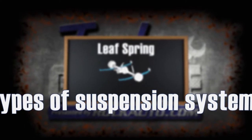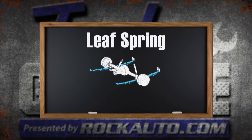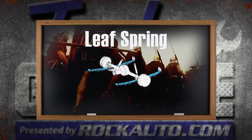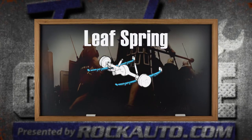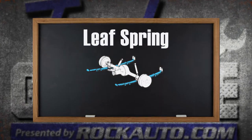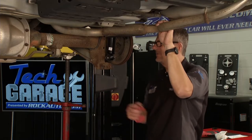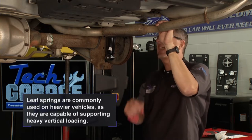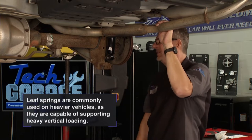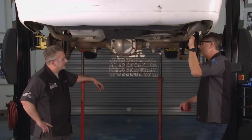While we're at it, let's talk about a couple of different types of suspension systems. First there's a leaf spring — that's the most primitive. In fact, it's been around since Roman times. They actually used pieces of leather to make leaf springs and it hasn't really changed much since then. They're made out of steel, but the basic design has lasted forever. They're usually on non-independent suspension systems. You've got a shackle on the back that allows it to change lengths as you hit bumps, a pin in the middle. When you're diagnosing those, just tug and pull them, make sure everything's secure, and look at your little eyelets.